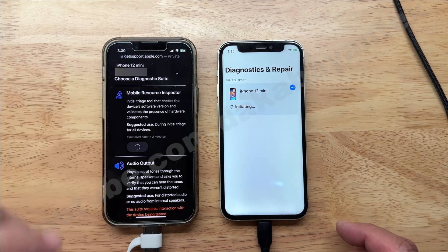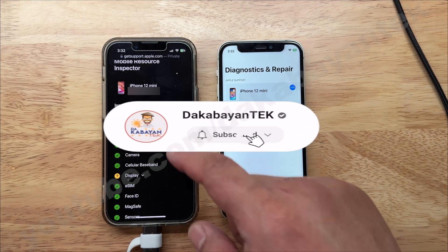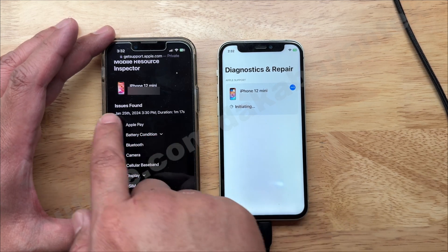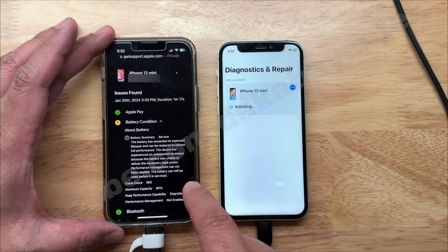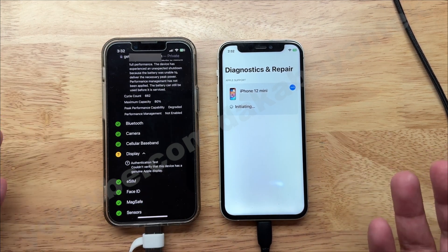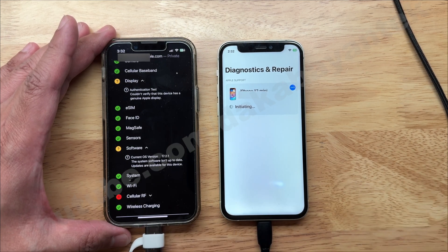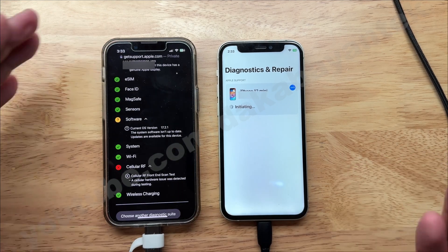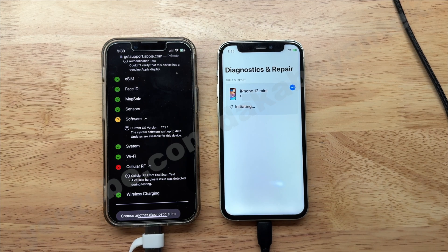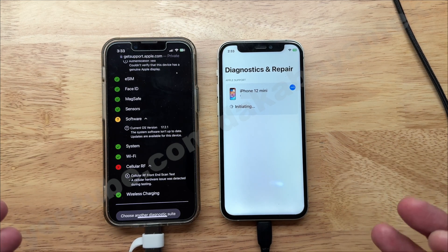Let's begin the diagnostics. This will usually take one to two minutes depending on your network and VPN speed. The result will be given on the phone you are using to run the test. The issues found: one, the battery condition is already in service mode. The display shows that the customer had the screen replaced through a third party — this doesn't confirm whether it's original or a replacement; the only way to know is to open it up. Next is software — there is a newer software available, which is 17.3. And then cellular RF, which has to do with the sensors related to signal. From this result you can inform the customer what to expect. If they want a back glass, display, or battery replacement, running diagnostics protects you because if you run it again and get the same result, it confirms those issues existed before the repair.